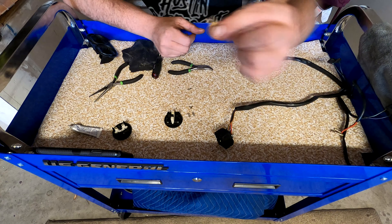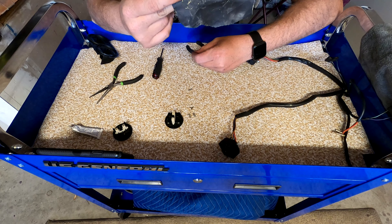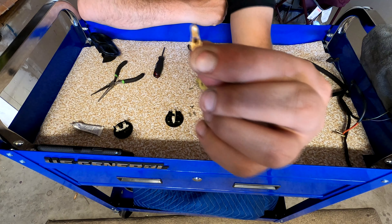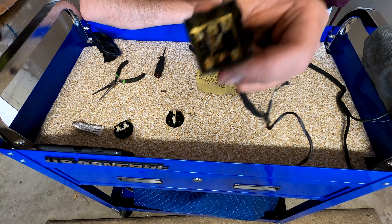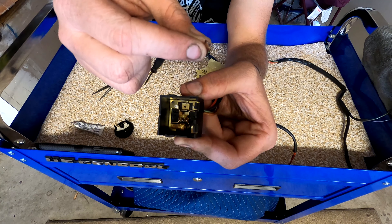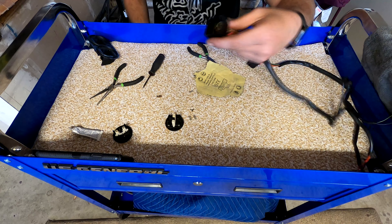Let me know if you guys like this style of video. You can see the circle right there. It's real simple to clean this - I've got 320 grit wet and dry sandpaper. All I'm going to do is put it around my finger - three passes, let's do four just because. See that? Nice and clean. Now I'll do the same thing to the pin, wiping the sandpaper down on it, and put it back in the same orientation it came off. Then I'll take a little bit of brake clean, not a lot, just a squirt, to clean it out.